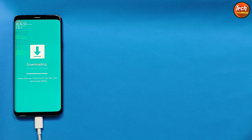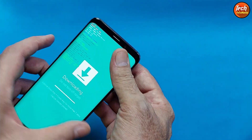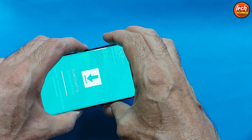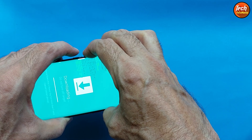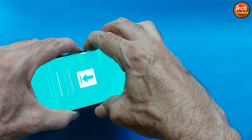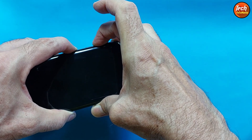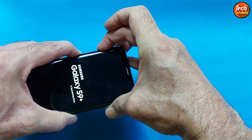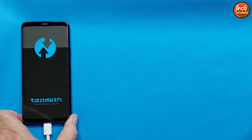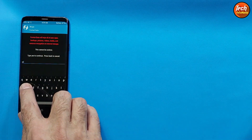Go back to the downloaded folder. The phone is still in Odin mode, so now we have to boot it into custom recovery. Make sure the data cable is still connected — do not disconnect it. Press and hold all four keys: Volume Up, Volume Down, Bixby key, and Power key together. When the set reboots, first release the Volume Down key. When the Samsung logo appears, release the Power key. After a few seconds, release the Volume Up key and Bixby key — the phone will boot into TWRP recovery. Swipe to allow modifications, tap Format Data, type 'YES' and confirm.